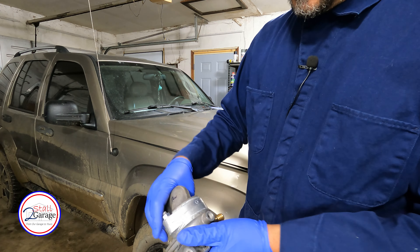These come from Robert Dis — you can find him on Facebook in the Jeep Liberty CRD group. This is going to be the temp sensor; we'll find out when we take the OEM one out of the vehicle. When you get that upgraded thermostat, it does come with a gasket. Put Permatex copper spray-a-gasket on the surface of the thermostat itself, then spray down the gasket and snug it right up. Don't over-snug it. You can find this at O'Reilly or Advance Auto Parts, part number 86226-80697.